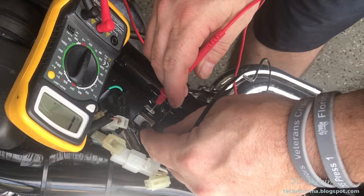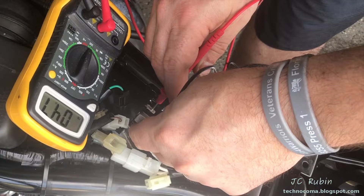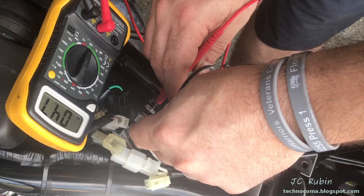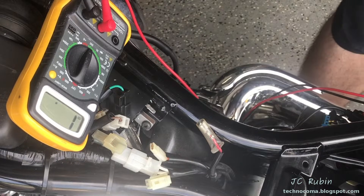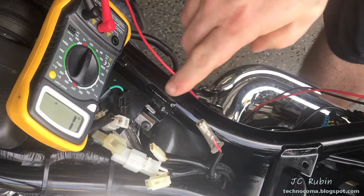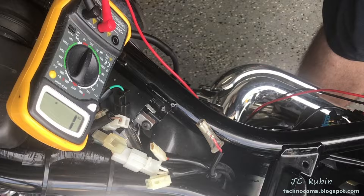We do our primary coil test. I'll measure the cables first — about half an ohm. Now going across the leads directly on the coil I'm seeing 4.8, 4.7 ohms. Subtract half an ohm, we get 4.2 ohms. It should be between 3.8 and 4.6 ohms, and that tells me the primary windings inside should be okay according to the resistance.